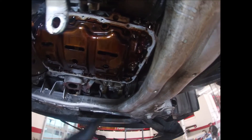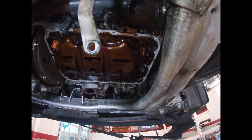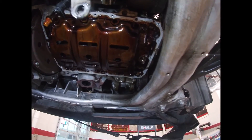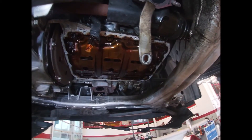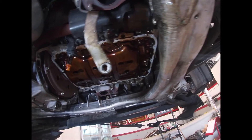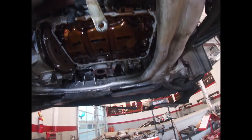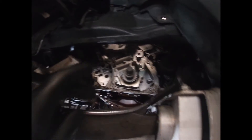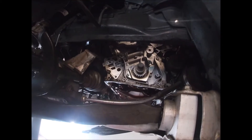Take all the bolts out of the pan. There's an O-ring right here for the oil pickup — you have to take the pickup off as well. Remove the dipstick just in case; I've seen it before where the dipstick gets crushed between the oil pan and the gasket surface and obviously leaks. I've got pretty much everything torn apart right now except for the oil pump. The oil pump is pretty simple — just a bunch of 10-millimeter bolts in the front.